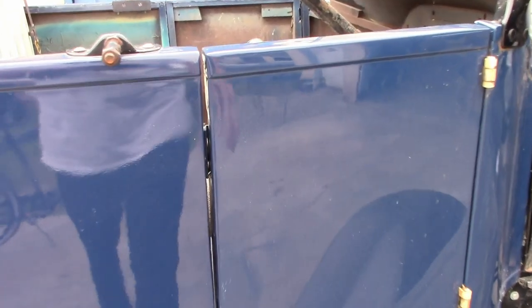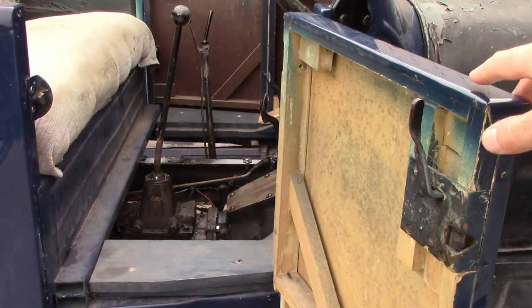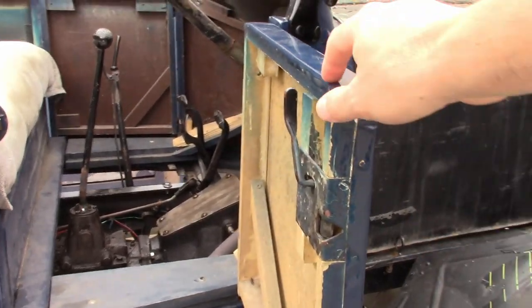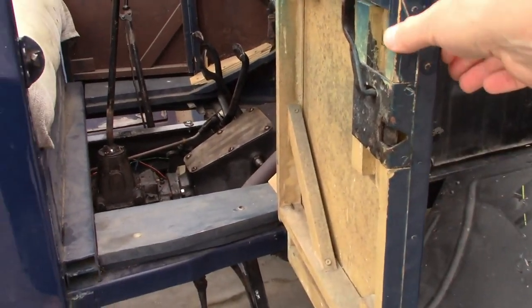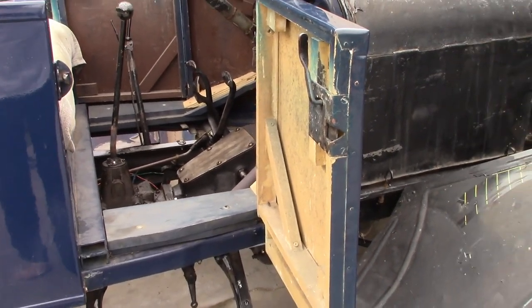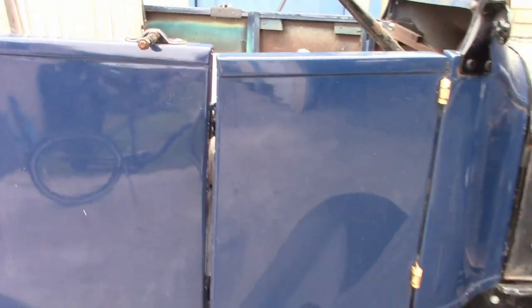The doors, like the rest of the cab, are just flat. As you can see, it's just a wood frame with steel over it. What makes it easy to make is, as you can see, if the panel's flat, I can just take a piece of wood, cut it to length, and assemble it — and that's it. And then just take a piece of sheet metal, just bend the edges over, nail it on, and that's it.